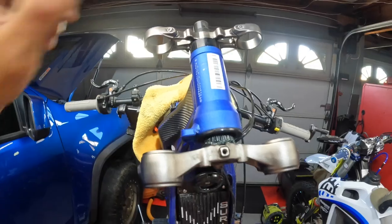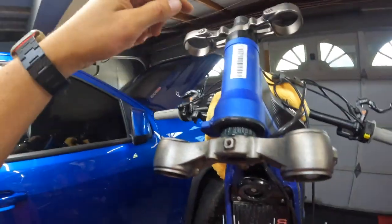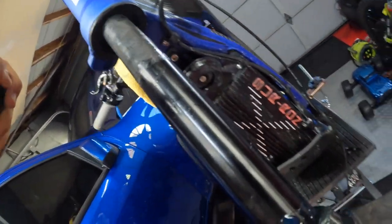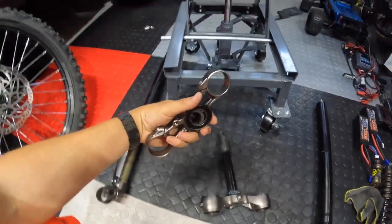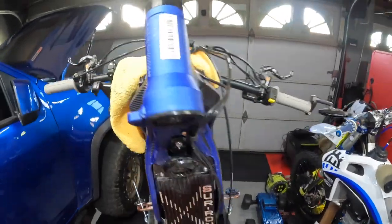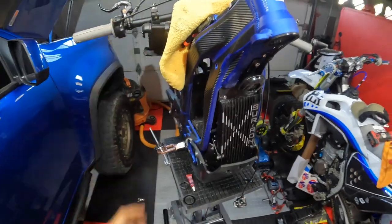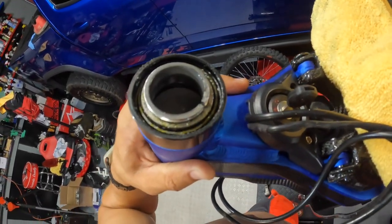Now this part's super easy. Just pull this top one off, this one at the bottom, and it'll come right off — and there's your stock fork. I'm going to place that upside down so I don't get dirt on it. Now you can literally just plop the new fork in there. Checking to see how much grease is in there — looking kind of good. I might add a little bit, stuff some grease up in there just to make it a little more waterproof.